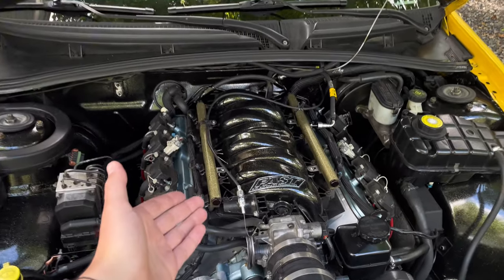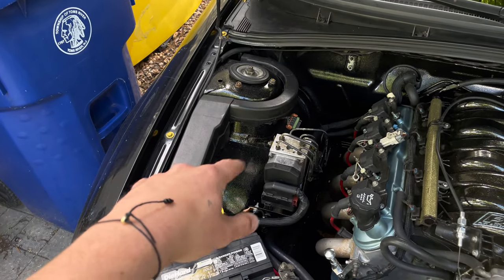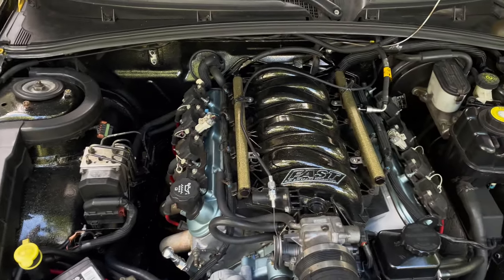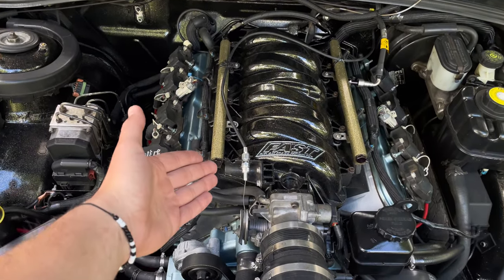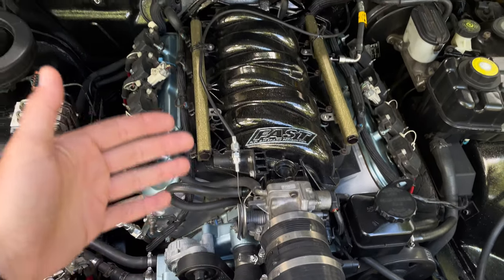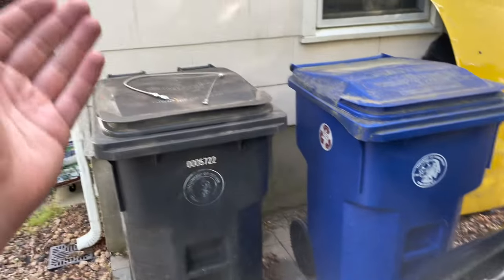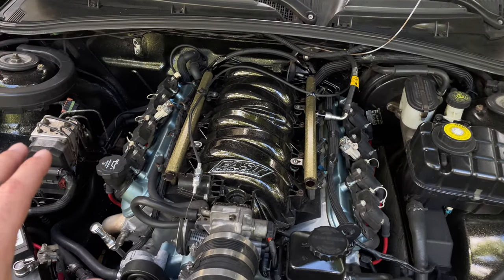But when I first installed this, when I deleted the, I believe it was traction control and cruise control, I want to say. That was the box over there I deleted, so it looked a little bit cleaner. I had to run basically a standalone throttle cable. I messed this one up. I trimmed off more than I should have, so it's technically too short right now, and due to that, it's just not in an ideal space. So what I did, again, bought a brand new one, I think it's 36-incher, and I want to try to see if I can set it up more legit.